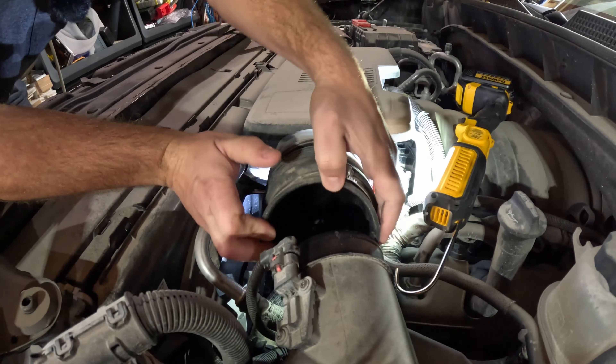Started rerouting the new belt — it's a stretch-fit belt. We're going to go down around the harmonic balancer and run some zip ties through so we can get the belt held down, then get the rest back on the pulleys where they should be. We're going to put a bolt on the crank and rotate the engine over to get the belt to snap on. I don't know why GM didn't use a tensioner pulley versus an idler pulley — I guess maybe to make you take it to the shop. Hopefully you guys can see the zip ties around that belt already routed up.